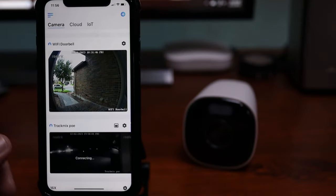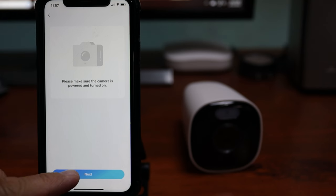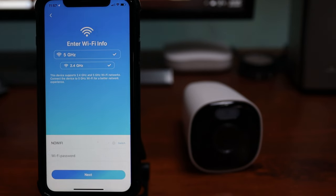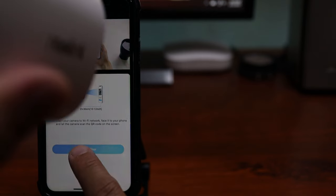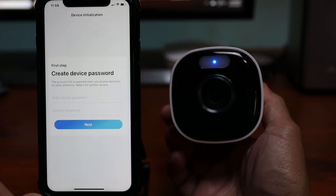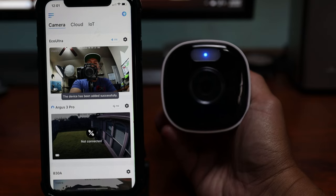Let's insert a micro SD card and set this up. Open up the Reolink app, click the plus sign, and scan the QR code on the side of the camera. Choose Wi-Fi not configured — the camera after charging is already on. It can connect to either 2.4 or 5 GHz Wi-Fi. Type in your Wi-Fi password, scan to generate a QR code to show the camera, wait until it connects, create a device password, name your device, and it should be added to the app.